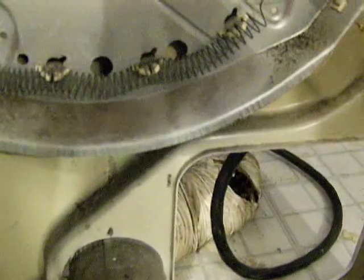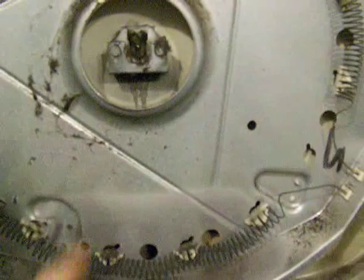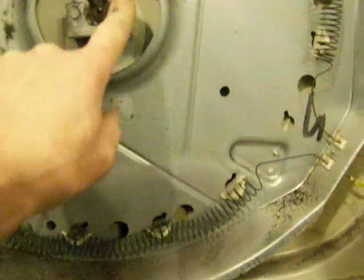There's an awful lot of grindings down here. I just don't know how that fits in there, what it is. I'm going to take that out. That looks like a fiber bearing. Hang on. Oh, wait, maybe I won't take it out right now. Not sure. Just a minute, guys. Okay, guys, that is some kind of nylon bearing in the backside, and it's pooched. You see right there. See that? It's screwed. That's what the squeaking noise was. It's been riding on the steel.